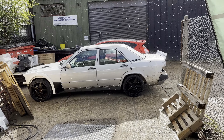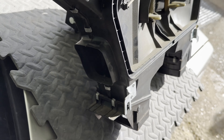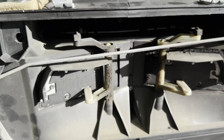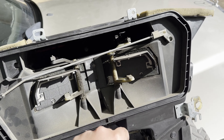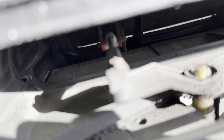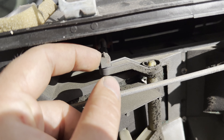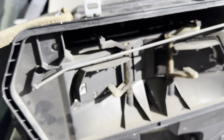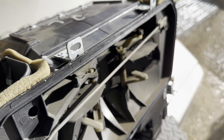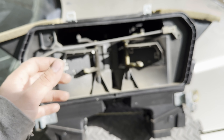It's raining now — right. So here's how this works: we need to unclip all these small clips which are pretty much everywhere on both sides, then three or four bolts up here — one here, two over there. We need to unclip that little clip so we can detach this panel. Once this panel comes out we can see inside — there is the heater core which needs to come out. I'll show you how to pop it out and then put the new one in, which is just a reversal of everything we've done so far.